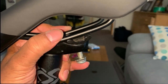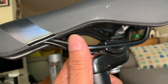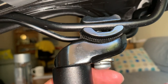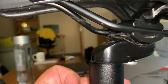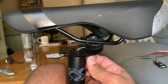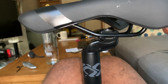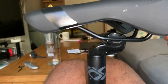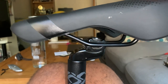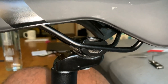You can sort out which angle you want it at — that's not the angle you want. The bracket will just sit on top. Once you get the bracket on top where my finger is pointing, hold it in place and everything should fit. Then gently tighten this screw with your finger while holding the pole. Make sure the bracket is there before you tighten it properly, because the seat can still adjust. It's better to adjust the seat when you're on the bike.